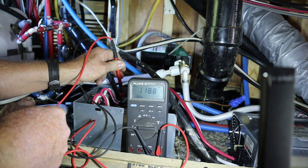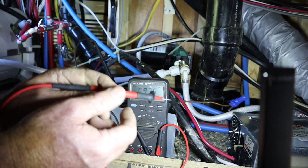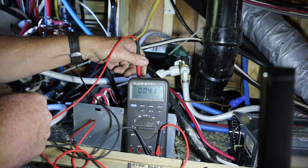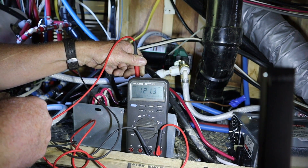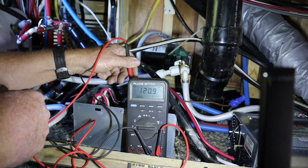Let's see if turning the breakers on makes a difference — yeah, that makes a huge difference. Let's see if it transfers now. We've got a green light over there on the other side of the transfer switch, so this does have a little board in it somewhere. There we go — we transferred, now we're making good power. So there you have it: the converter is working because we replaced it, the transfer switch is working, and it's transferring power.